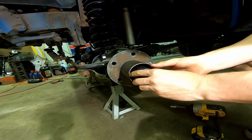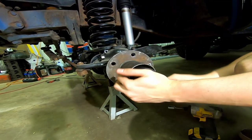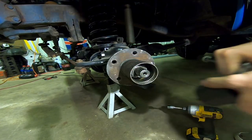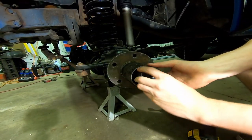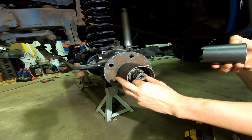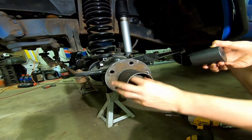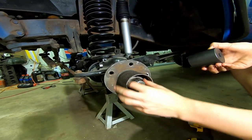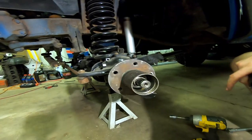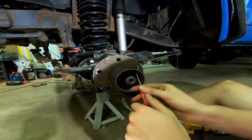The next major thing that needs to come out is the spindle nut, and you've got a special tool - it's a spindle nut socket. This one's two-and-three-eighths. You just get it here, hopefully line that up, get your ratchet. Should have just come off pretty easily, in theory. And then behind that there's a little collar lock - it's kind of hard to describe as I don't know the technical terms. But then you'll have another one of these spindle nuts right behind it that'll have a little nipple on both sides that you're supposed to lock or set that collar up with when it goes back together.